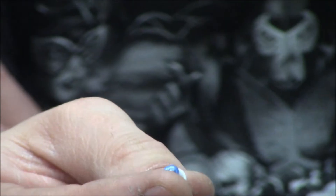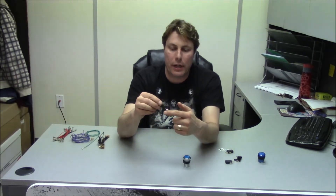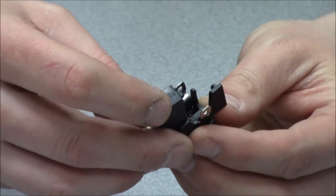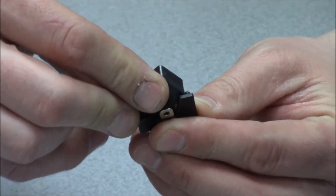Sometimes they do die in a month — they're all mass produced overseas and you can't guarantee that hundreds of thousands of these LEDs aren't defective. Now, it doesn't matter which way you actually plug this LED into the lamp holder itself, you just have to make note and do them all the same way to make your life easy. I always put the single strand wire — my ground wire, the thick one — on the long side, or the mount side, of the lamp holder.